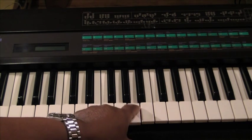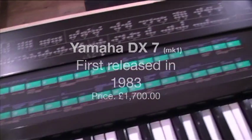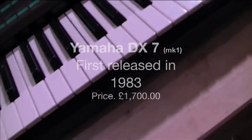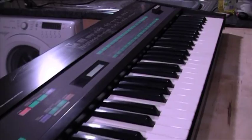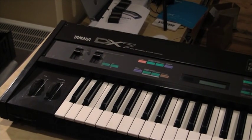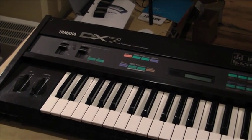He also said at one time he smelled a burning smell, so that's typical of probably a capacitor or something burning out. There was also no keyboard response and no sounds from the cartridges when he went to load them. The reason for this is that the DX7 is now coming up to 30 years old, and back in the day people would use them in the studio for three or four hours, then pop out and forget to switch it off — sometimes it's probably been on for days.